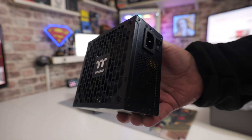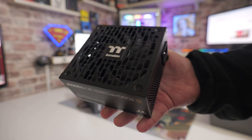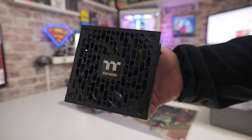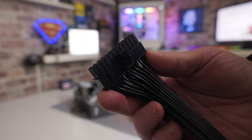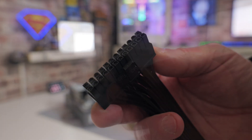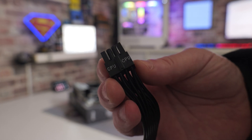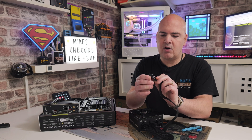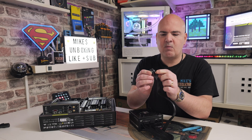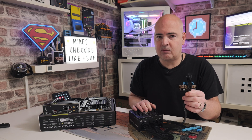Other things you're going to need: a power supply, and in order to actually power the board whilst you're doing the flash, you'll need two types of connections — one is the main 24-pin power connector, and the other is the CPU 8-pin or 4-pin power connector, ideally an 8-pin. Most power supplies these days will be 8-pin anyway. If you're not too sure which one it is, have a look on your power supply — they will generally have 'CPU' written on there so you know it's the right one. It's easily confused with the PCIe connector, which is not compatible.